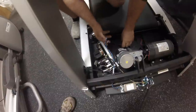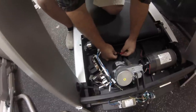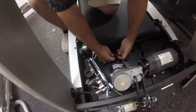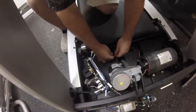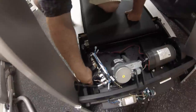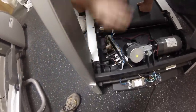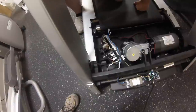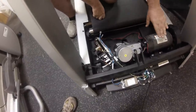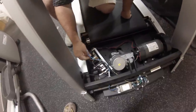Normally when it's a component attached to the board, we can identify it because it will trip the breaker when we command the component to operate. In other words, if it's in the lift motor, we command the lift motor to move and the circuit breaker will trip. Or as soon as we press speed up on the drive motor, the circuit breaker will trip.